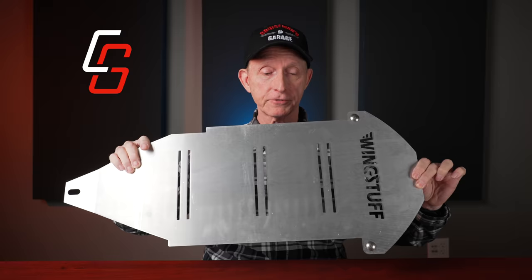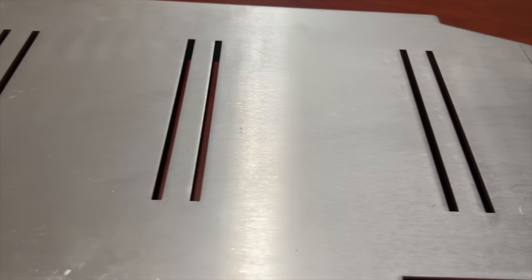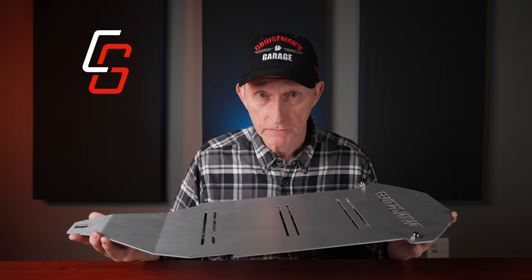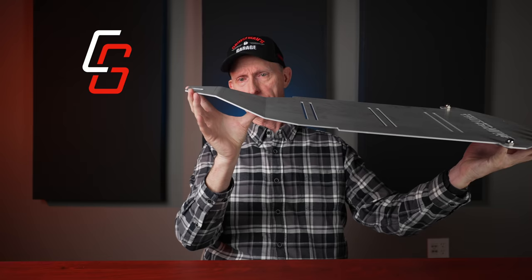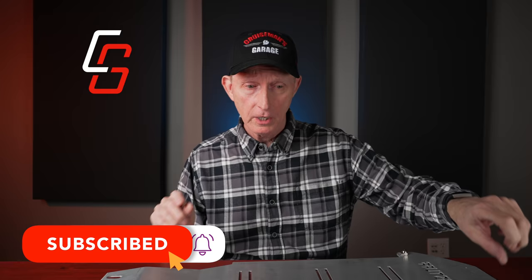The final version is a step back to the first iteration with a couple of important changes. It's a solid plate with no cutouts for the oil filter or drain plug. The idea is that you simply remove the skid plate to change the oil. The designer has also added a small bend, which I think is for fitment purposes.